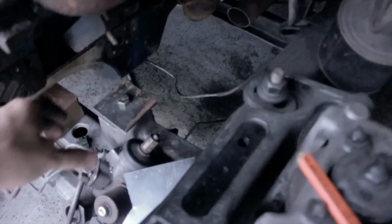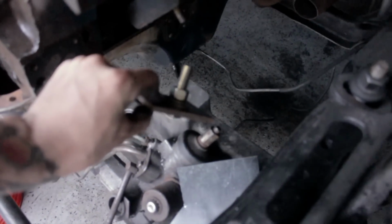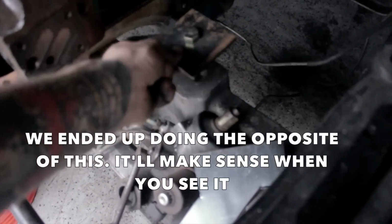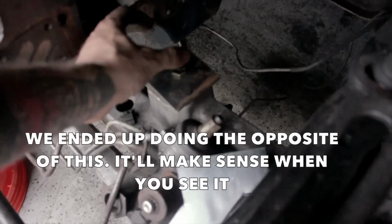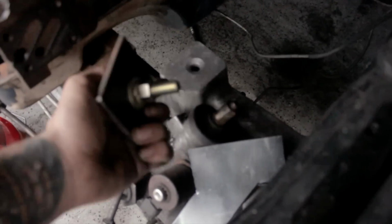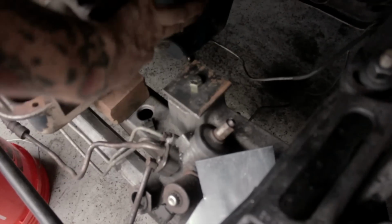The way this is going to work is these plates will be flush down here. This bolt will have these connections on the bottom up through the pedestal. So on top, it's going to look like this. We're going to weld this nut to the plate, and then weld the square stock that we fabricate to this plate. Then we'll be able to bolt everything up through the bottom with grade 8 hardware and lock washers, so this is bolted down, and there's a fixture that hits here, bolted to the engine.